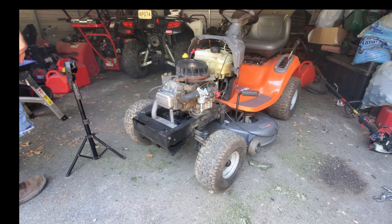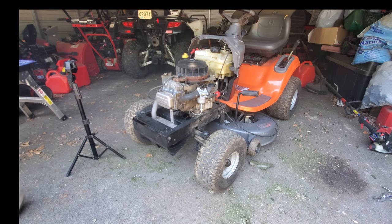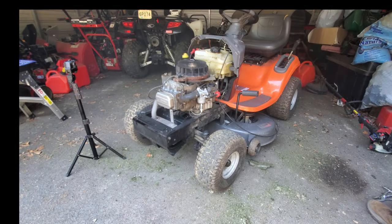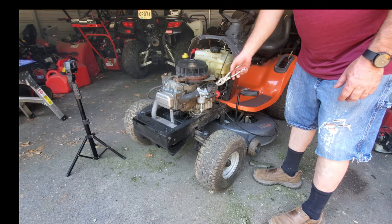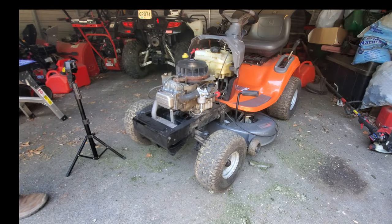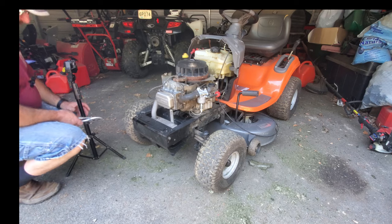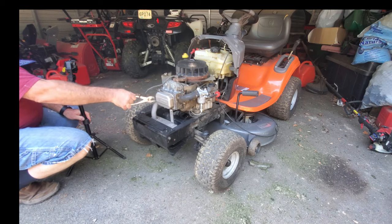But one thing that I found when I opened the hood and looked around a little bit was that, for one, the choke won't close. The choke seems to be stuck. It's a new carburetor here. That choke may be stuck against the housing to where it's going to be very difficult to start. And it's going to be starting lean. And usually a lean condition could make it backfire out the carburetor. It actually did that for me. I think it used up the carb cleaner. And then it was trying to start just on gas without any choke.